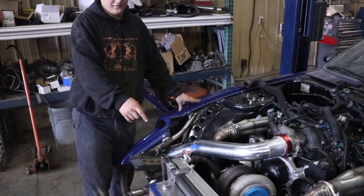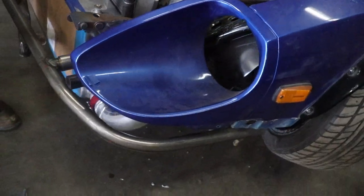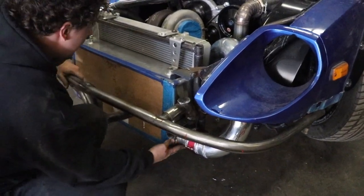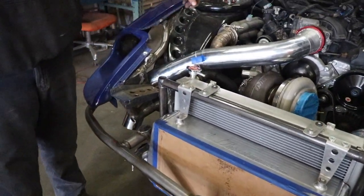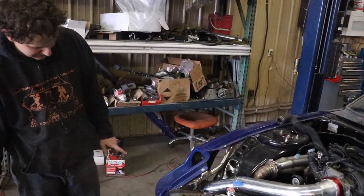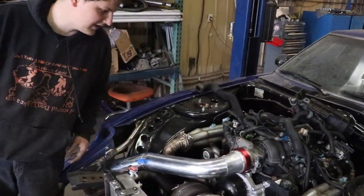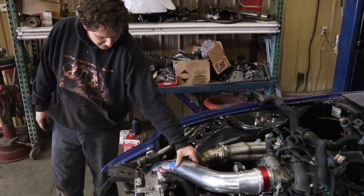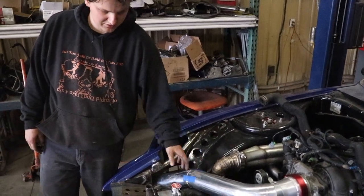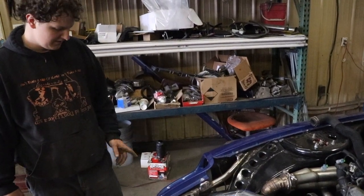I just finished up the outlet from the turbo to the intercooler. There's a 90-degree bend down here and then the clamps I welded on to the intercooler in the last clip. I started running the side from the throttle body down to the intercooler as well - I had to make a 90 there. We have the four-inch on the throttle body, using tape and a sharpie line to scribe the clock position on the bench. Just getting this side mocked up and then we'll make that 90 and should be done.